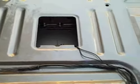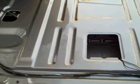Now when you remove the tailgate cover, which is going to be necessary to install your switch, what we did was we came into the first block on the top. We took the switch, and it sits just on the very first plate. When you remove this front plate, and this is a standard zip tie, I think it was 10 inches, to hold it in place. Now the switch has to be kind of put in at a ramp. This has to actually be inclined, set back farther on the bottom than it does on the top, so that when the tailgate closes, the lights will shut off.